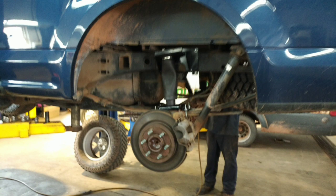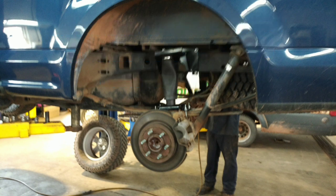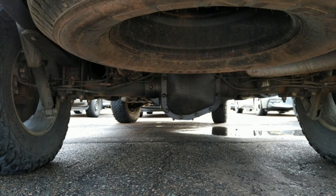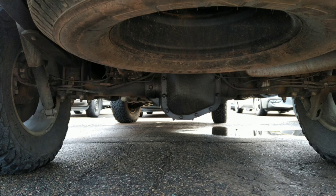The manufacturer can derate the axle based on the fact that they don't want you to go as high as the maximum. They change it usually with derated wheels or derated tires. This is meant to be a resource for everybody. I'm going to post a bunch of pictures like this one — this is my axle. That's not a leaky axle, by the way, that's undercoating, but you can recognize this 975 axle at a glance.